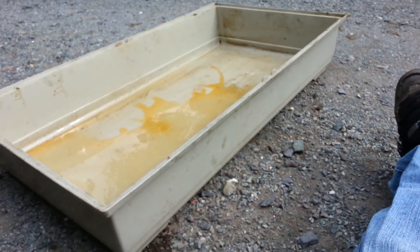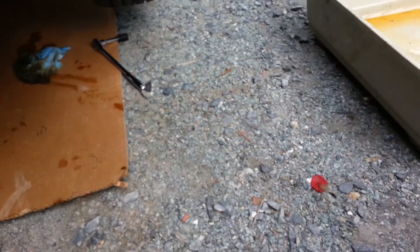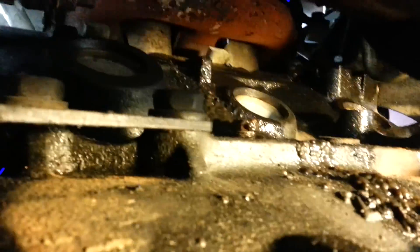Now there's one on the flip side of the engine. It's supposed to be near the exhaust manifold, and I'm seeing people say on the boards that this thing is impossible to get to - they're talking about freeze plugs and all kinds of stuff. I've had no trouble on most engines finding the drain plugs. There's some out there that don't have them but they're pretty rare. There it is - the big circular thing is a freeze plug, and right below that is a bolt head sticking out, and that is the drain plug.